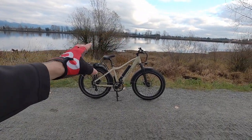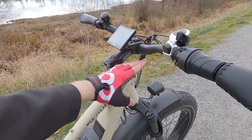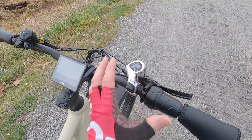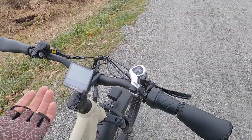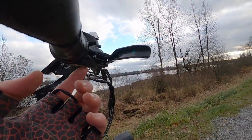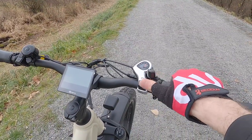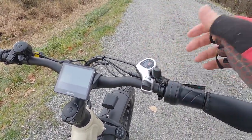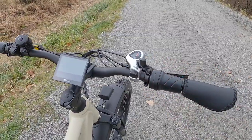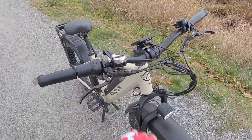Again, one frame size but four colors. If you want a more upright ride, you can get a shorter, steeper-angled stem. Up here, this is the shifter — it's a really big SIS index shifter, kind of entry-level in my opinion, but a lot of companies use it because with the twist throttle the housing protrudes and triggers just don't fit. This bigger one requires a little bit more reaching and effort, but it's decent — especially if you're wearing gloves, because the paddles are so separate and not tiny little triggers.